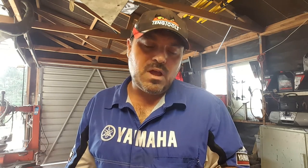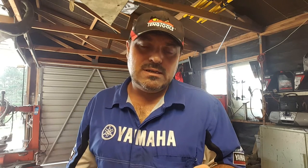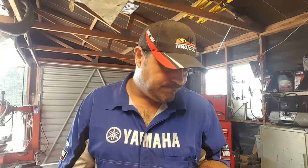But there's a few things that I do know, and I found these units really helpful when it comes to trying to diagnose a fault on a car where maybe it's just not quite running properly, or it's a bit hesitant, or it coughs every now and again. Those odd little faults that you check with the multimeter and you think, well, it's within spec, it's all good. Quite often, it can be a faulty sensor, which is giving a slightly defective reading to the ECU, and that's causing something to happen that you don't want to happen.